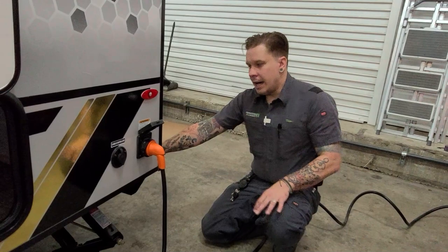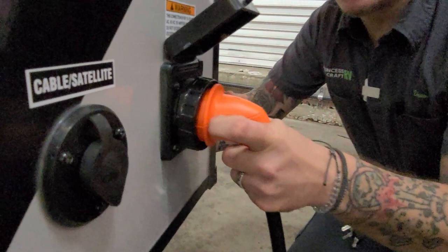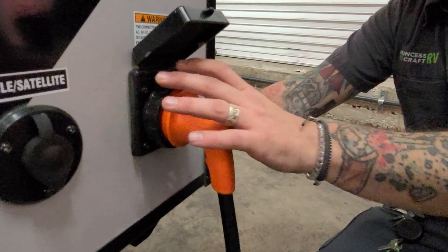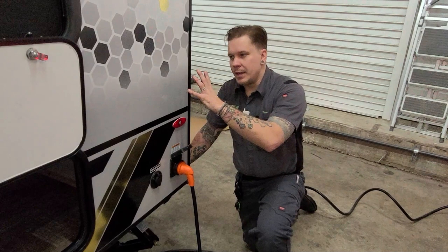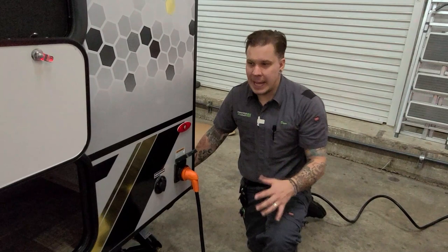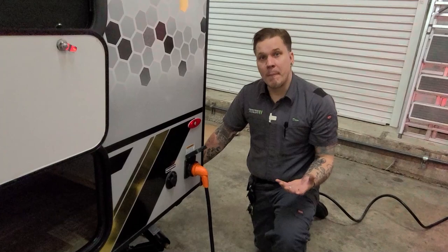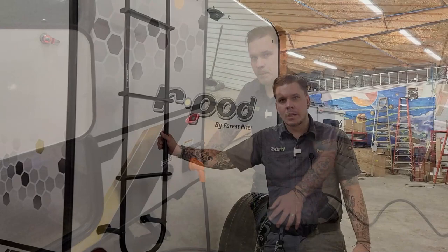Beside that, we have your 30-amp 110-volt connection or power supply. This plugs straight into the unit — line up the two slotted receptacles and one L-shaped, plug straight in, give it an eighth-inch turn to the right to lock it in, and screw down the secondary collar to lock it in further. My recommendation for every single unit is to add a surge protector in line. It's very important to protect the electrical appliances within the unit from environmental surges, substandard wiring, and dirty power. If you have any questions on the products we recommend, feel free to give our parts department a call.